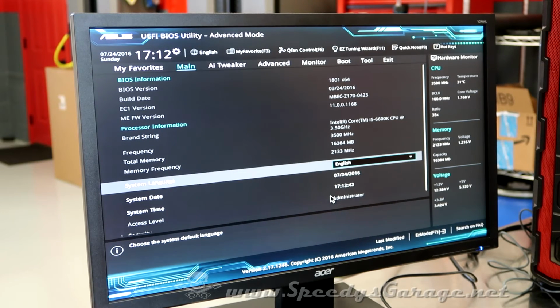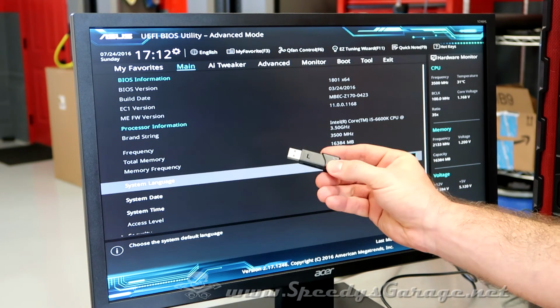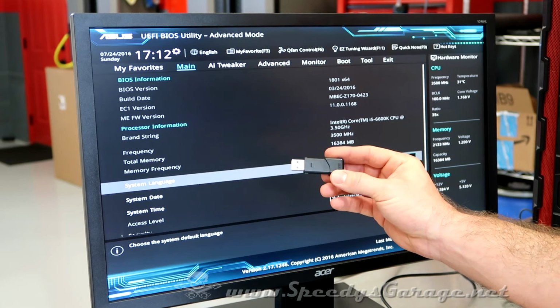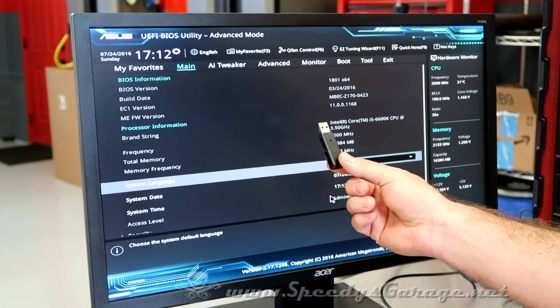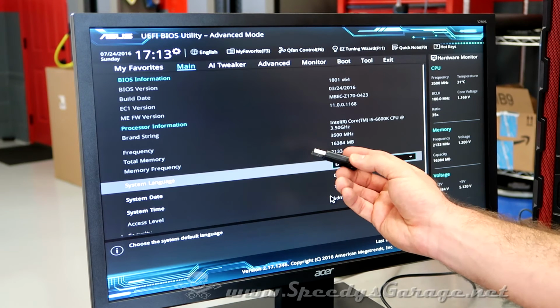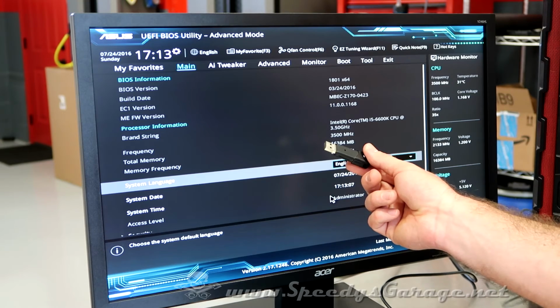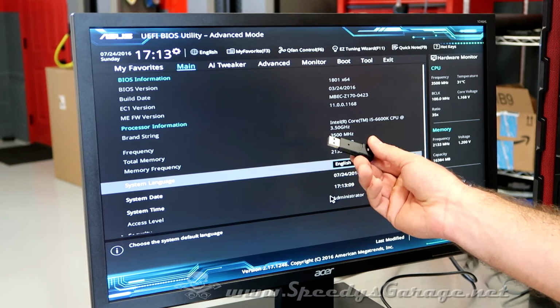So we'll just reboot, and nowadays you do it all through a USB key. So you go online, I'm gonna do Windows 10 on this machine. There's a tool you download from Microsoft. You obviously have to have another computer to do this. You point it at a thumb drive like this and you tell it where it's gonna locate the install. Then you have to have the Windows ISO, grabs that, makes you a boot key to do your operating system install. I've never done it before, so let's see how that goes.